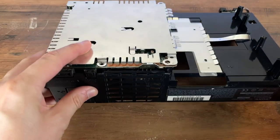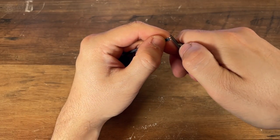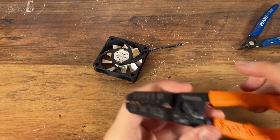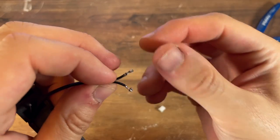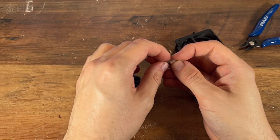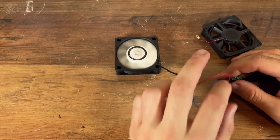The RF shield still fits, and no I don't need to insulate it as everything is safely away from the metalwork. All that was left to do was cut the fan leads — after I made absolutely sure which one was power — and then crimp on a new PH connector. I'm using a pair of Engineer PA24 crimping pliers, and for small connectors like the JST connectors I totally recommend using them for this task. I connected the fan to a 12V power supply just to check that I had the leads crimped not only with the right wires but also in the right polarity.